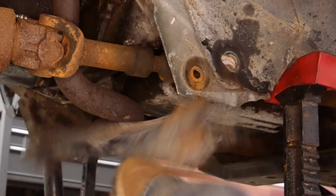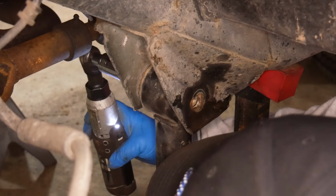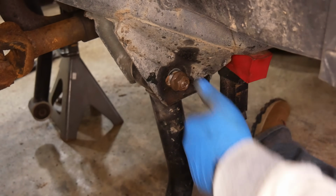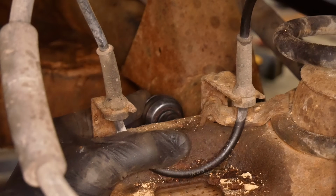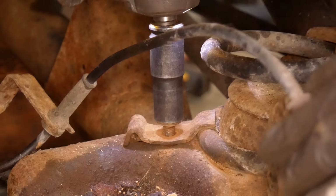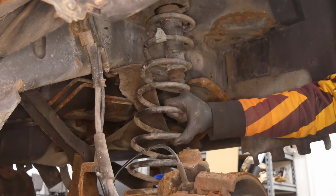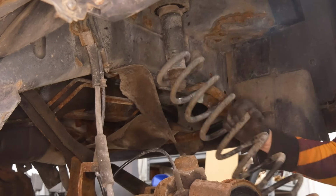Get that crap out of here. Which makes room for the new aftermarket arm. For the moment, we'll leave that hanging from the mount on the body while we remove the factory coil springs. Starting on the passenger side, we'll remove this bracket holding the speed sensor wire so that we can get to this hold down that locks the coil spring to its perch. Then, with just a shove downwards on the axle, we can pull the spring right off.